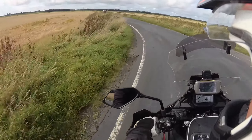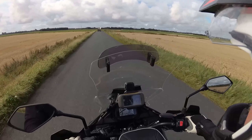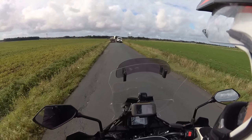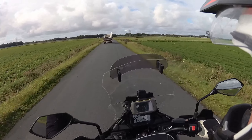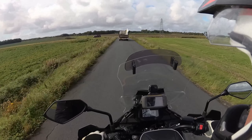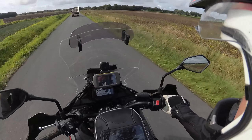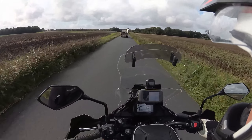Cutting to the quick — what I decided was that the softer preload and the rebound control had to go further than I thought. When you push the back of the bike, the rebound really does work. This is proper bouncy here — you can see the scars in the road. This is where it scores, because the rebound was getting that bouncy wallow, almost wanting to catapult you out of your seat. So you need a pretty firm spring and pretty firm compression, with enough rebound control.